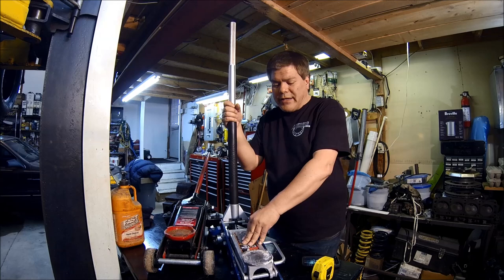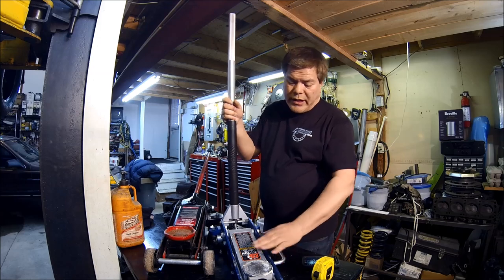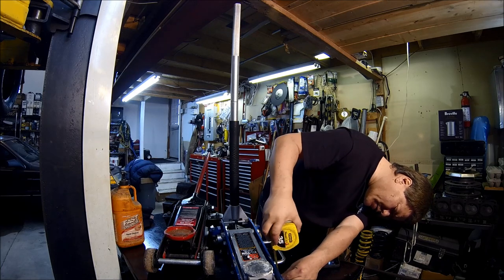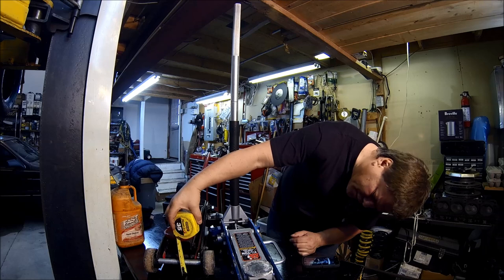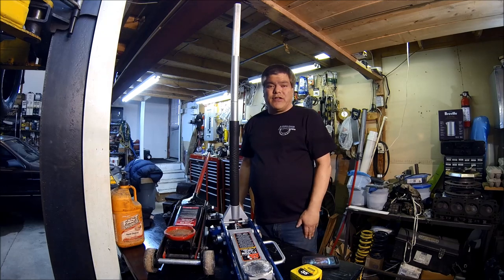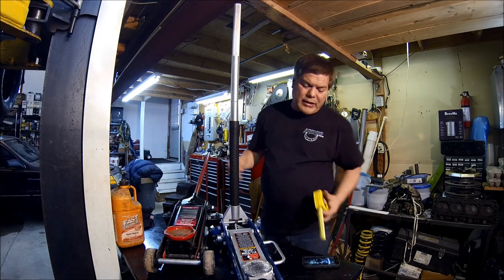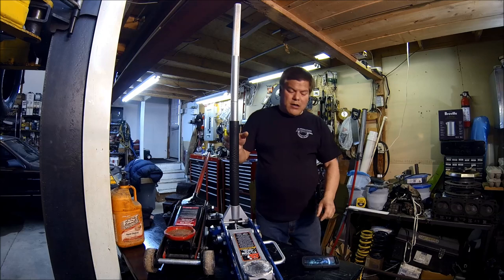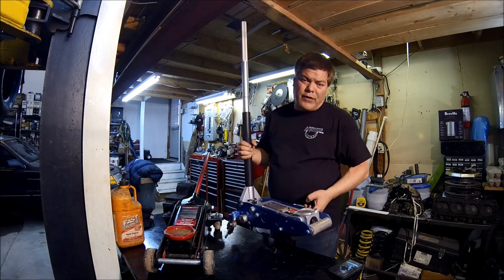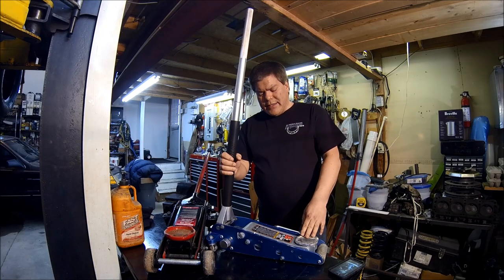The advantage of these small aluminum jacks is that they're lightweight. You're not swinging them around, which adds safety, and of course they get underneath the car. The total height of this jack to get to the rise is about 3 1/4 inches, whereas these big ones are 5 1/2 to get underneath the car. Our ride height in our chassis, in a lot of cases, is 5 inches or less, so these big jacks just don't work for us. That's one of the reasons you have a scalloped and a narrow chamfer on the jack, as you can see. And they're lightweight and fairly easy to carry, but we'll get into that more on the jack itself.